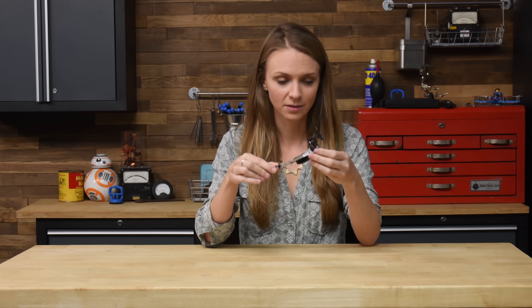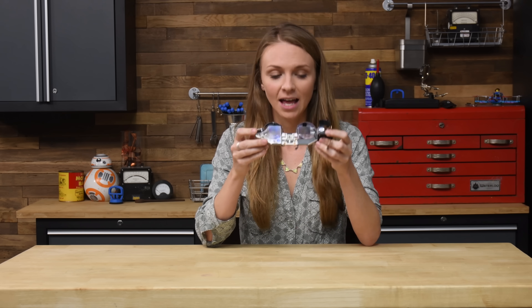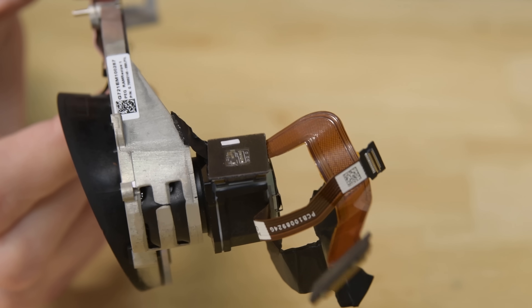So what does this all mean and how does the Magic Leap actually work? There are two sets of RGB LEDs that generate light. That light is directed onto a liquid crystal on silicon display that reflects the light based on wavelength to form and project an image.